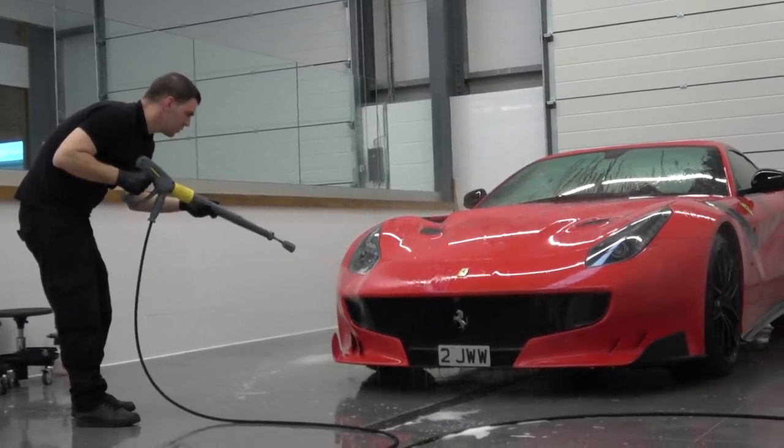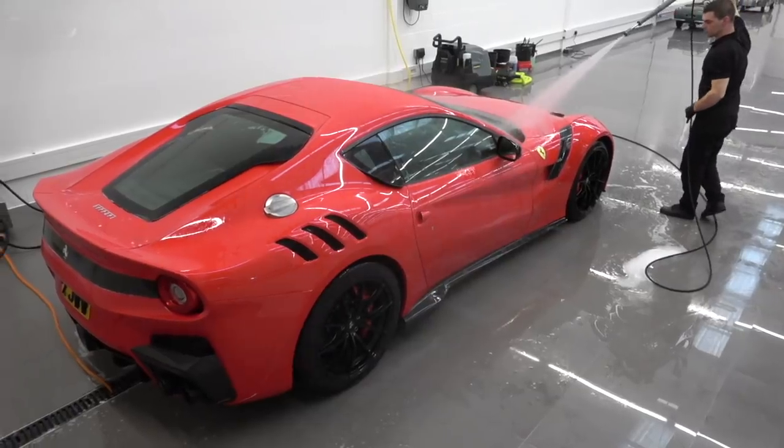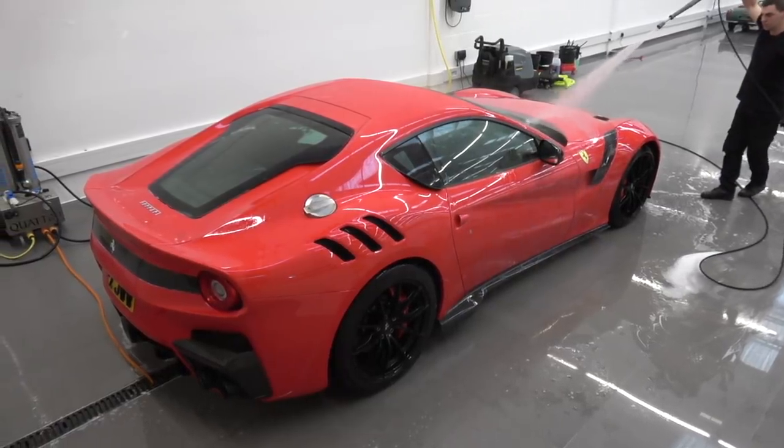So that is the basic wash process of the wheels — we've got three more to do exactly the same. On to the bodywork. Next stage: body wash. First, we're going to rinse the car with warm water. Second, spray some citrus degreaser over the vehicle. Then spray some iron to get rid of contaminants on the paintwork. After that, we're going to snow foam the vehicle — my favourite part. Then use a two-bucket method to wash the car. Finally, rinse the car with pure water. By the time our wash mitt actually hits the car, it should be 80% clean so we don't cause any more damage.